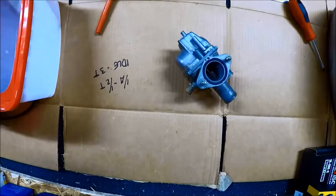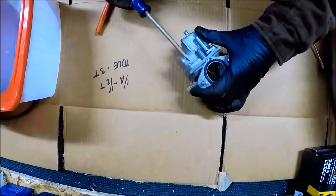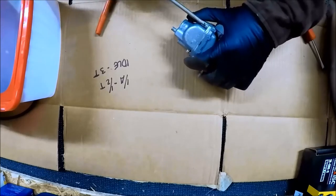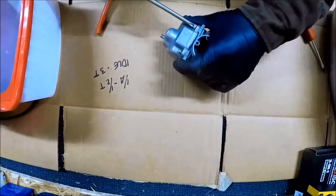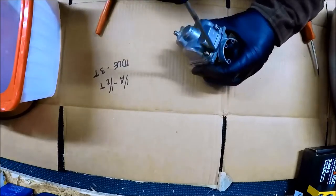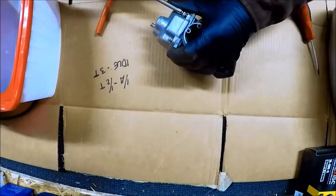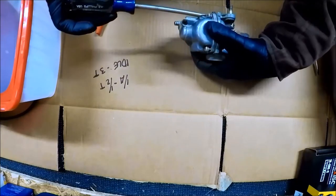This didn't cost me all that much, so I'm expecting this to be kind of a mess as far as cleanliness goes — from the pictures I could see on eBay, everything was here except for the choke assembly. Lucky for me the guy was selling the choke cable with the choke assembly on the end of it, so I had to buy that too, but neither one were all that expensive. Another thing I can see: looks like there's some gas sealant around this float bowl — I can see it squeezing out here. So I know I'm going to need a new float bowl gasket based on that.